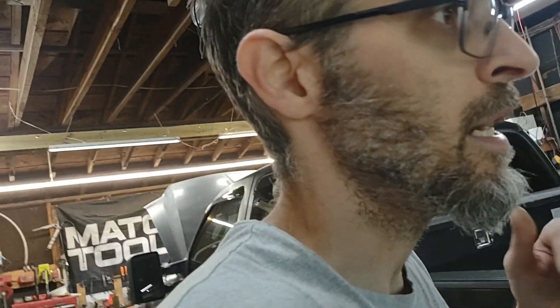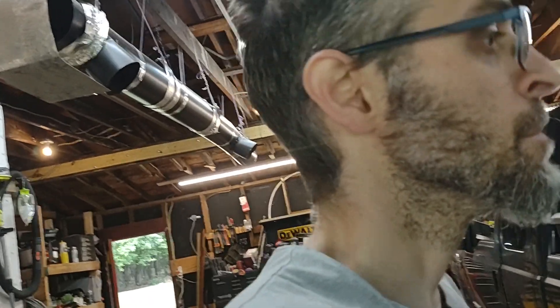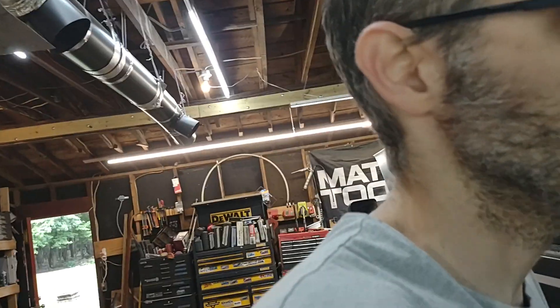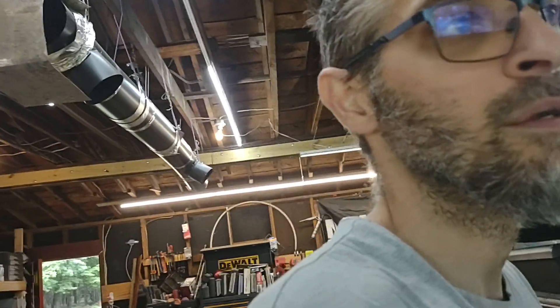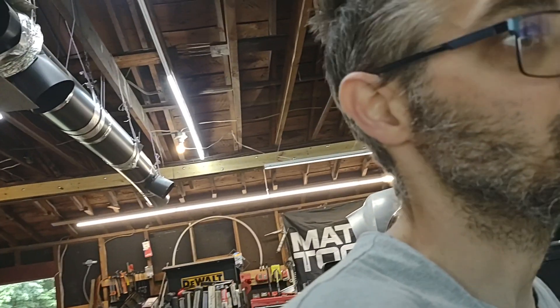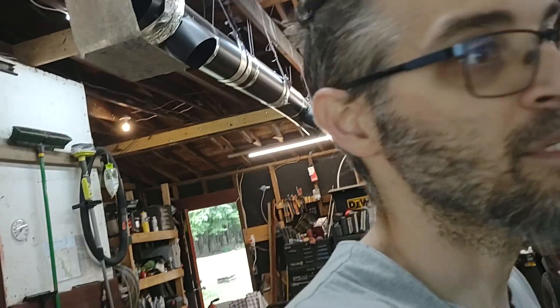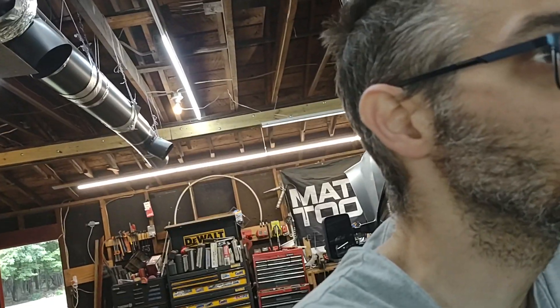When you set it up, you've got one SSID, one wireless name. When you go on your wireless settings, you just click that name. It doesn't matter if it's an IoT smart device like an Alexa, a smart plug, or a bulb — whatever you're setting up for a smart home. It connects perfectly and auto-negotiates to 2.4 GHz. Or if you've got an older device, it connects on 5 GHz. Or if you've got a newer device — maybe a Samsung Galaxy S22 Ultra — it connects on Wi-Fi 6, and it'll show a little '6' on the Wi-Fi symbol on the phone. Everything's been working good.